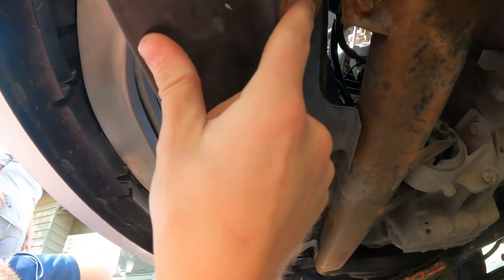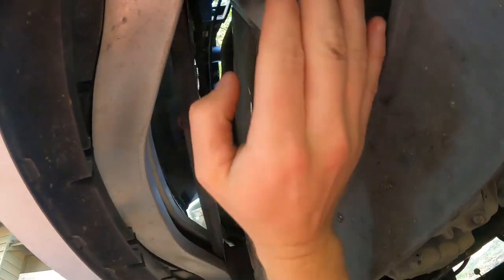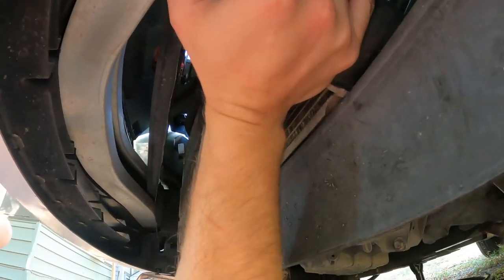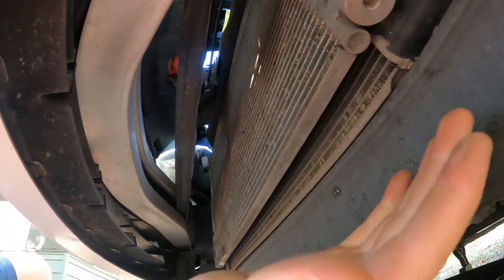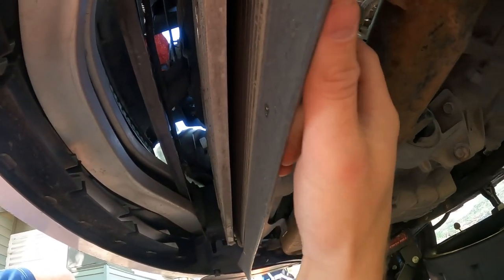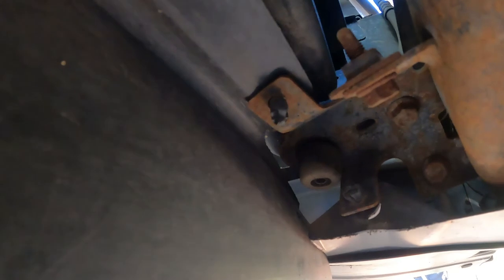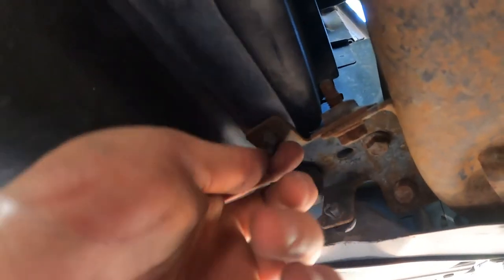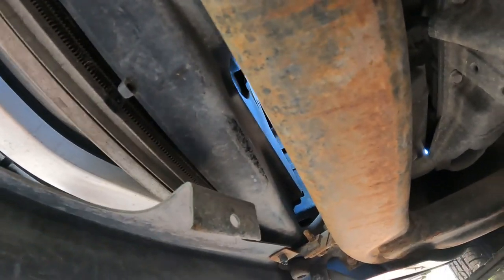What we've got to do is push these little pins out, and then we'll be able to push the radiator all the way up — just like this. That will get us some wiggle room so we can suspend the radiator and get the actual fan part out. So for these little push pins, we push the radiator up and pull this little cover out, and that will give us a nice amount of room to work with.